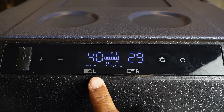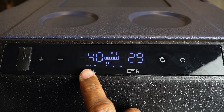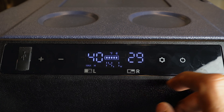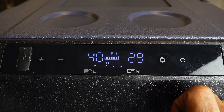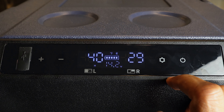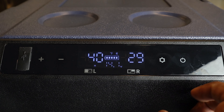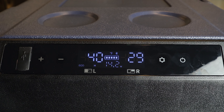If you look right above the left zone symbol, it says MAX. That means the fridge is in max mode to cool down as fast as possible. You also have the ability to put it into ECO mode, which will save power. To switch between those modes, hit the settings button — it starts flashing, press it again and now it's in eco mode. It'll wait a second, stop flashing, and you're all set.